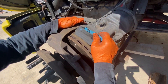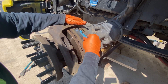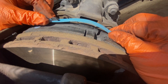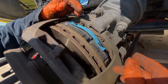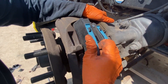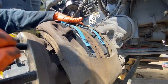This is how easy it is. Sometimes, because it's a new brake pad, it's hard to get it lined up and get it in — but it went right in. You've got to make sure it's lined up with your disc brake. It's actually a little bit inside — so if your brake pad is sticking out like this, that means it's not all the way in. You don't want to tighten it and put it back like that. Make sure it's all the way in and lined up, or maybe a little more inside. Once it's lined up, it goes right in.